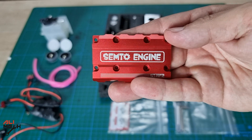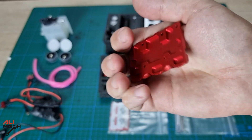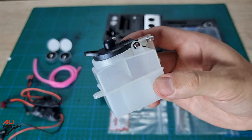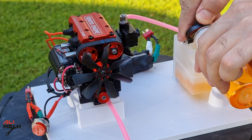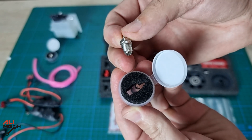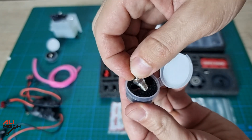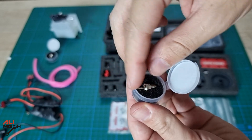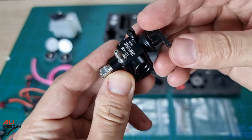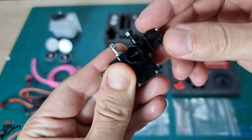Here are some of the parts. This is the engine cover — the quality looks very good compared to the engine size. This is the fuel tank, which will be filled with 20 to 25% nitro fuel. This is the glow plug and it will do the spark plug job. Whenever the engine uses nitro fuel and has a glow plug instead of a spark plug, you don't need separate oil because nitro fuel contains oil and it will constantly lubricate the engine.